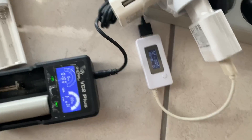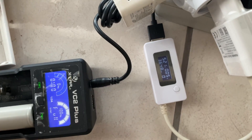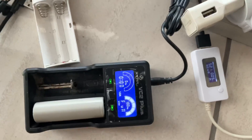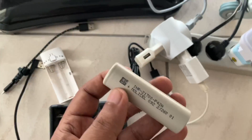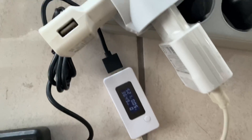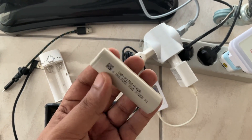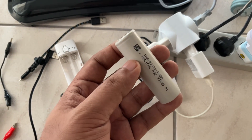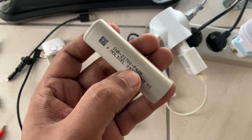The one thing I want to tell you: the second time I tested, this battery started charging from 3% remaining. So it charged a total of 3649 milliamp, but it already had three percent battery when I started charging. Adding that in, it's estimated around 4100 milliamp total — and the rated capacity is 4200 milliamp. So I consider this battery perfectly accurate.